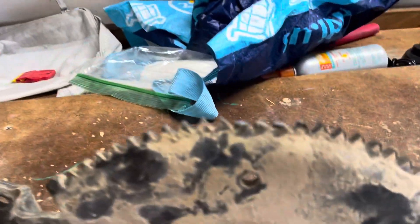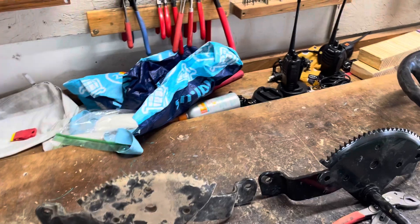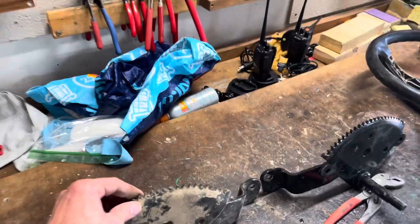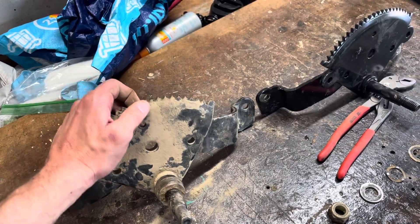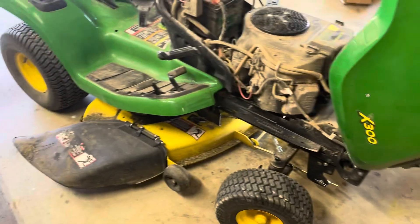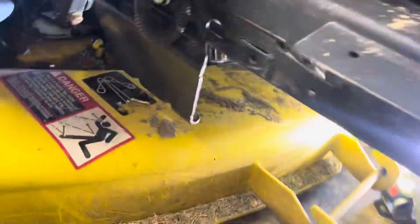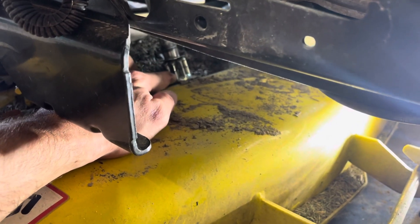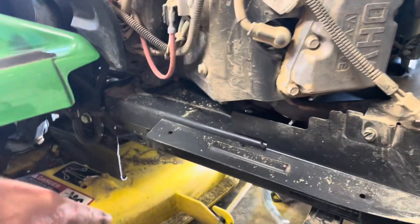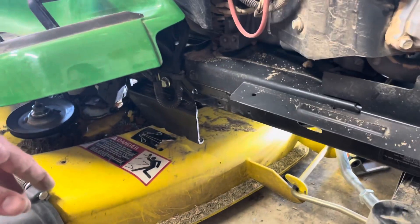The customer complaint could be: only turns left, only turns right, steering feels bad, or who knows. This rack is not hardened, but the gear down there is. In my case, the gear was in good enough condition and didn't need replacing. If it did need replacing, as far as I can tell this is a solid shaft all the way up, so you would have to drop the deck and really lift the machine up to get that out. So hopefully yours is okay.